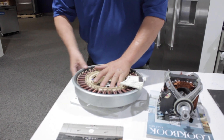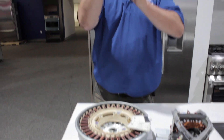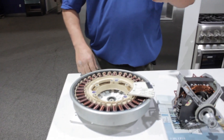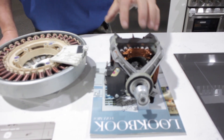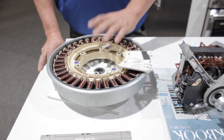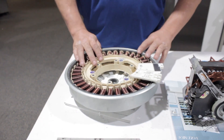This does not move - this is what moves around this. So as this attracts it, it'll actually pull it up to it. And then once it gets up to it, it's going to change to neutral, and then the one right next to it's going to pull it and it's going to go all around. As fast as I can alternate it, as fast as I can make this thing go. So it's using very little power to actually roll the tub. Where the AC motor requires more power to go faster, this one I don't - it's just how fast I can turn the magnetics off and on in reverse.